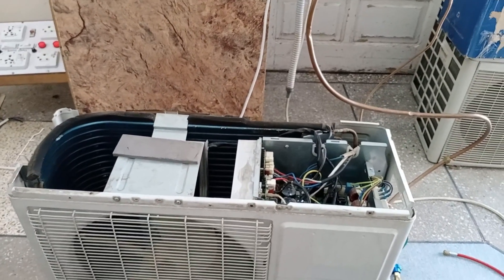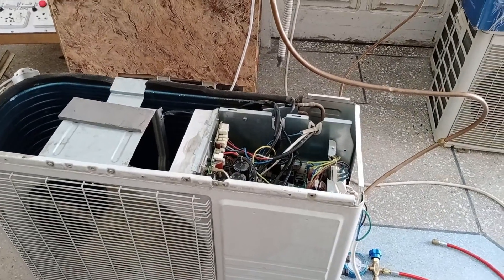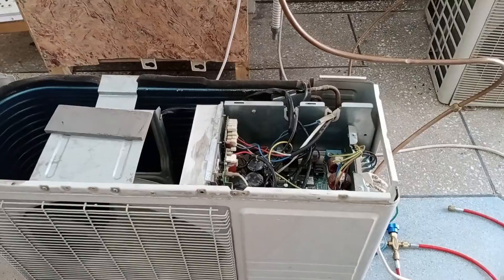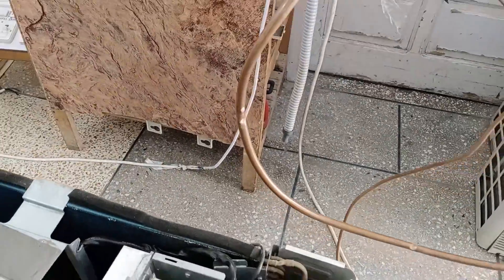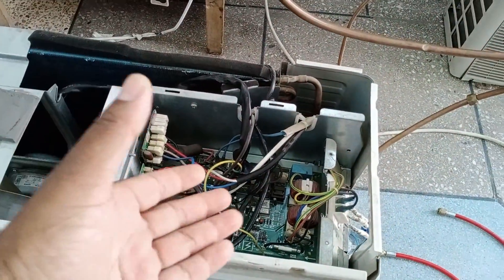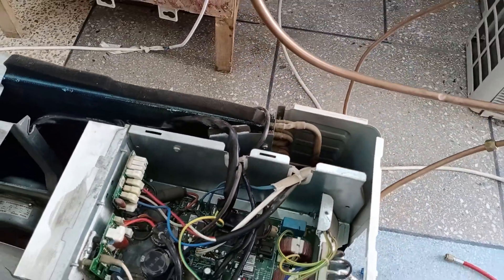The compressor will not be able to bear the excess pressure of the refrigerant. You can see that the air conditioner is so efficient that it senses the unit is overheating and starts showing an error code accordingly. I have also seen another common problem: when an old air conditioner is shifted from one place to another, the pipes become stiff after long use. When these pipes are reinstalled, they start to bend — this crooked pipe puts a load on the compressor. The IPM, which runs the compressor, will overheat and the unit will stop working. The expansion valve or capillary tube could be another reason for overheating if they are blocked.